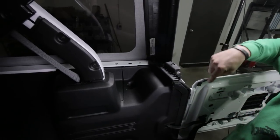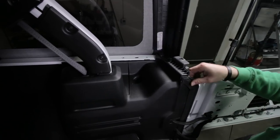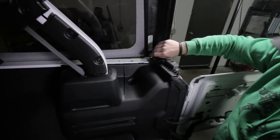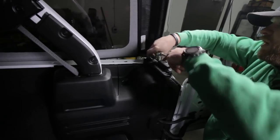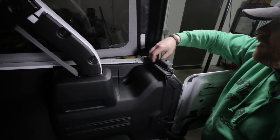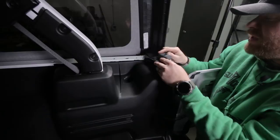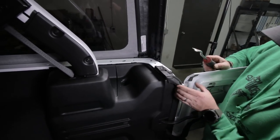To get the wiring from the tail light to the tailgate, we have to go underneath this plastic here. We need to get this rubber out, which is covered by the plastic portion of the soft top. The first step is to kick out the C-pillar part of the soft top, then use a T-50 to remove this bolt. Once that's done, pull off this plastic piece, which gives you access to this rubber gasket.